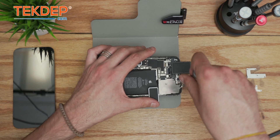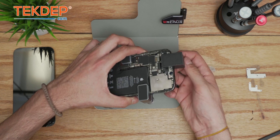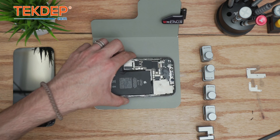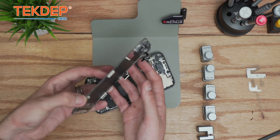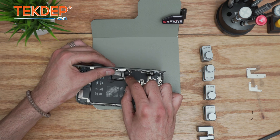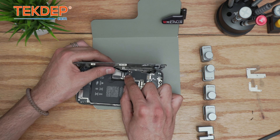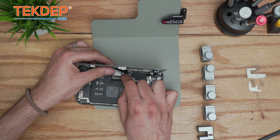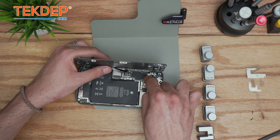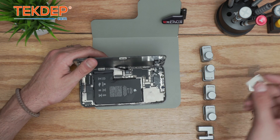Better safe than sorry. Once connected, start by removing the clamps. Now reconnect the screen. The customer didn't want to fix his screen, which is why we accepted the job the way it was — other shops considered the cracked front screen too much of a risk. The total price we gave him was essentially just the cost of the camera part itself. Reconnect the front proximity sensor and LCD digitizer, keeping the battery disconnected while doing so.